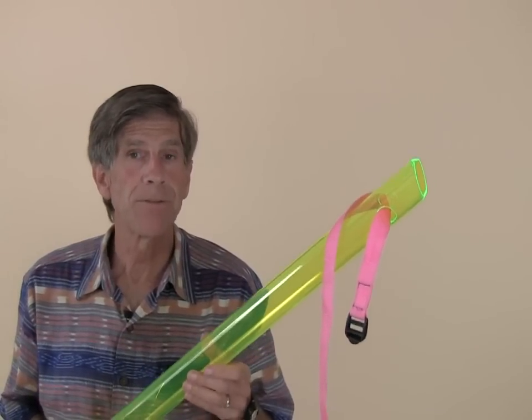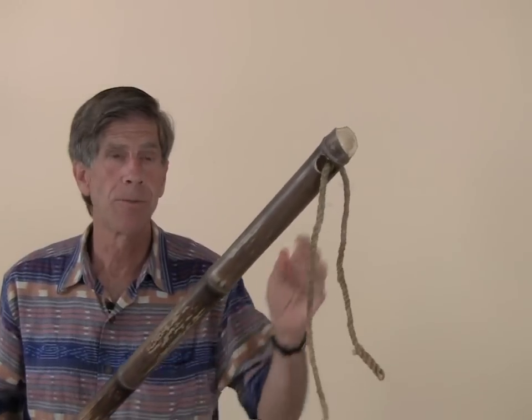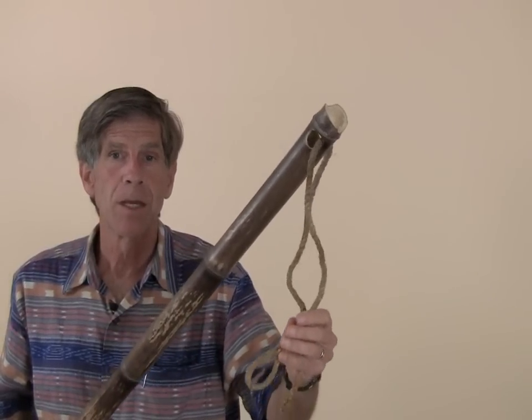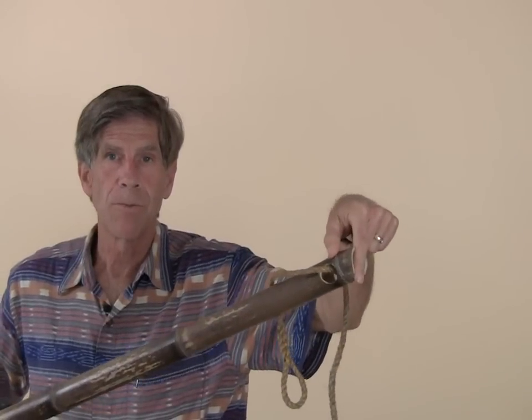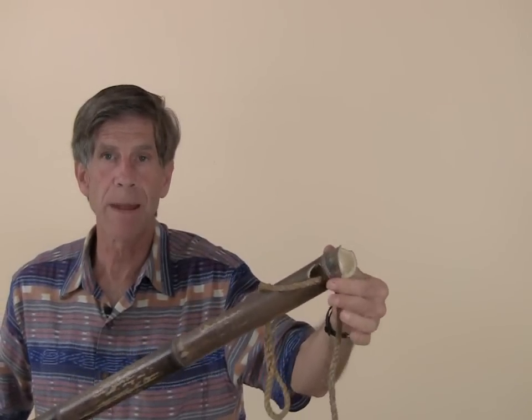On the other hand, colored acrylic is expensive and brittle. Bamboo is good because it's a renewable material and it's readily available in many tropical countries. I've also used another renewable material, hemp, to make the strap out of a piece of hemp rope. If you're working with bamboo, make sure that you drill the upper and lower hole and the strap holes on opposite sides of one of the bamboo knuckles, because the bamboo knuckles are the strongest part of the bamboo.